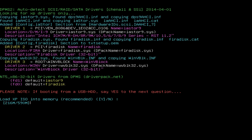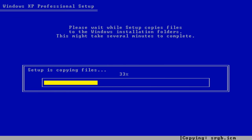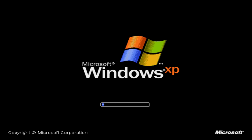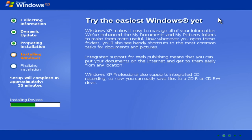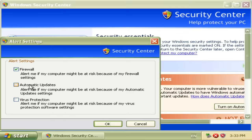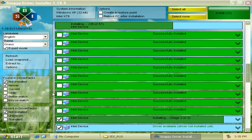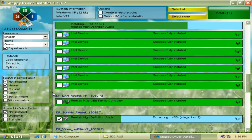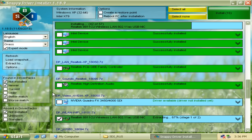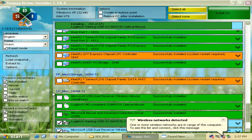The Windows XP installation was pretty straightforward. I'm using a 120 GB SSD and in the BIOS I've got AHCI SATA mode enabled. I'm using Easy2Boot — I've done a tutorial on that — which lets you install Windows XP from a USB flash drive, and that worked pretty well. You can press F11 on these Chinese motherboards to access the boot menu. To install all the drivers I'm using Snappy Driver Installer, it's about a 14 or 16 GB download onto a USB hard drive so you have all the drivers offline. I'm also getting the latest Nvidia and Radeon drivers directly from the AMD and Nvidia websites.